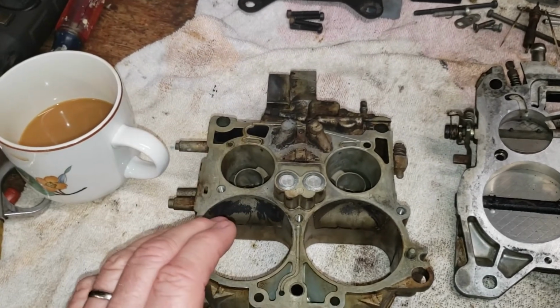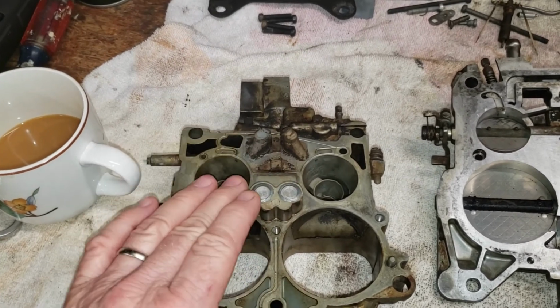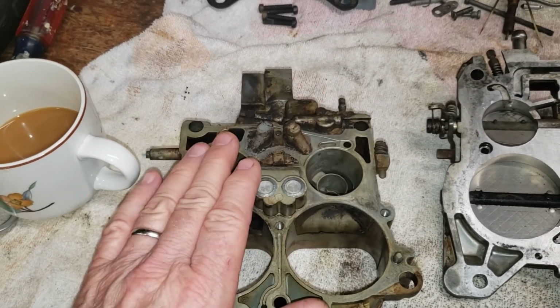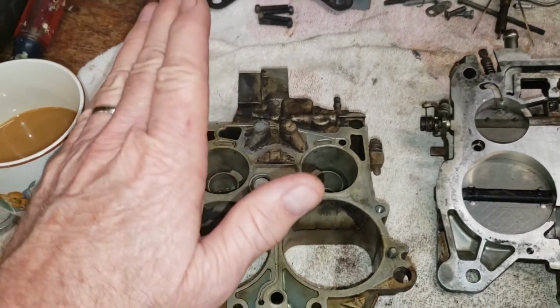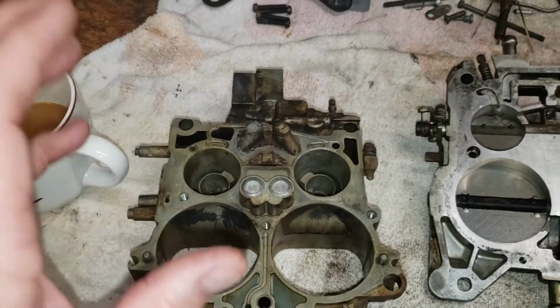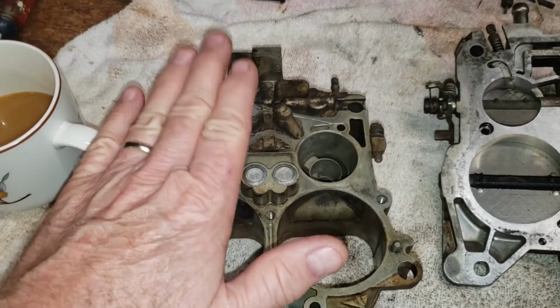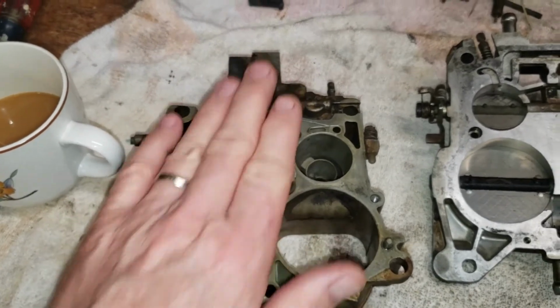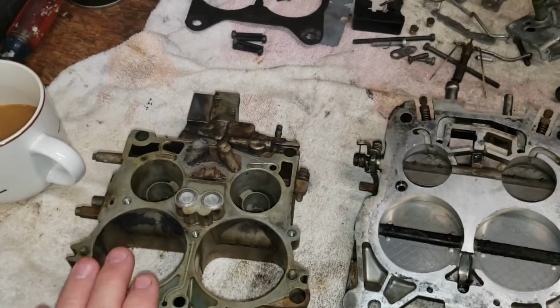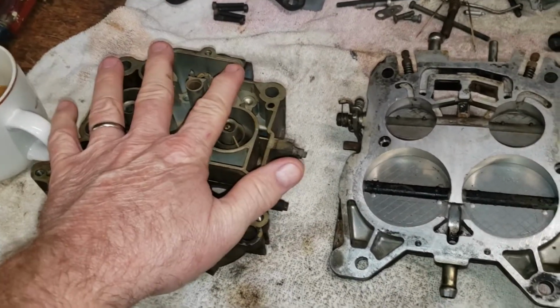And the epoxy that we're going to use is made by JB Weld, but it's called Water Weld, spelled just like it sounds. And it's supposed to be impervious to water, gasoline, diesel, and all those things. So I would not recommend using regular JB Weld. We're going to use a JB Weld that is designed to be impervious to gasoline. So I think that'll turn out pretty well, really. So we're going to get this piece cleaned up and sealed up.